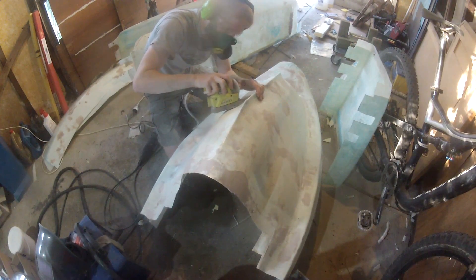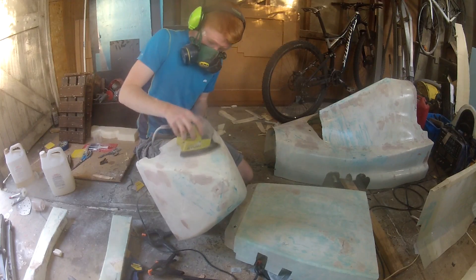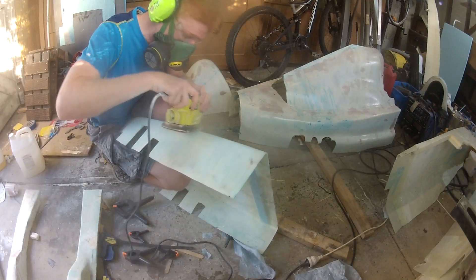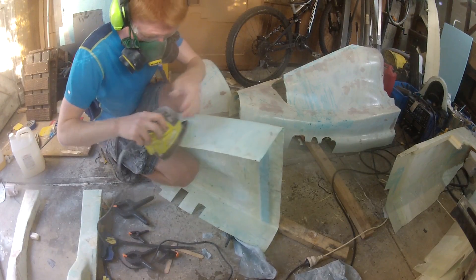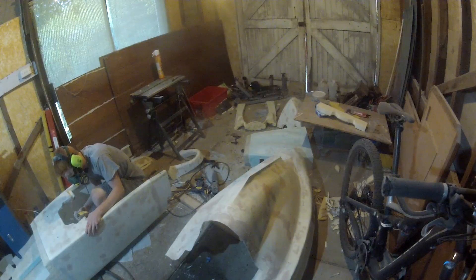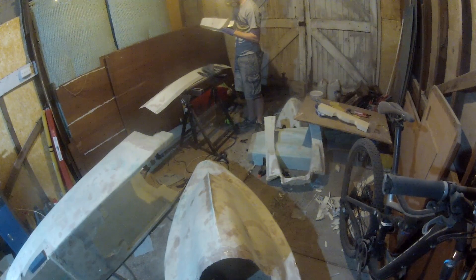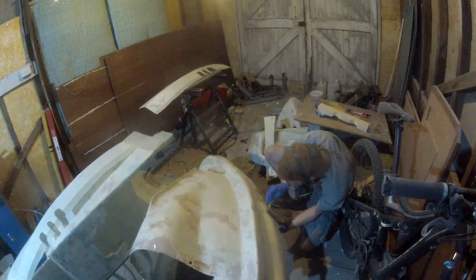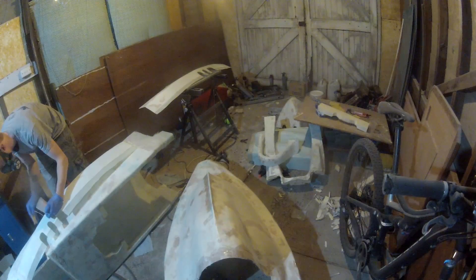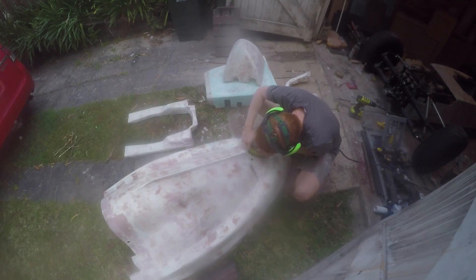Like with the bodywork plug, a long bog and sand process was now required to achieve a decent result. The bodywork also needed to be stiffened in strategic locations, particularly the main bodywork section, which still had to be flexible enough that I could stretch it out to get it over the chassis. And finally, the pieces all had to be made to fit with one another. Each of these tasks happened concurrently over three or four months as I worked towards the general goal of finishing the bodywork.